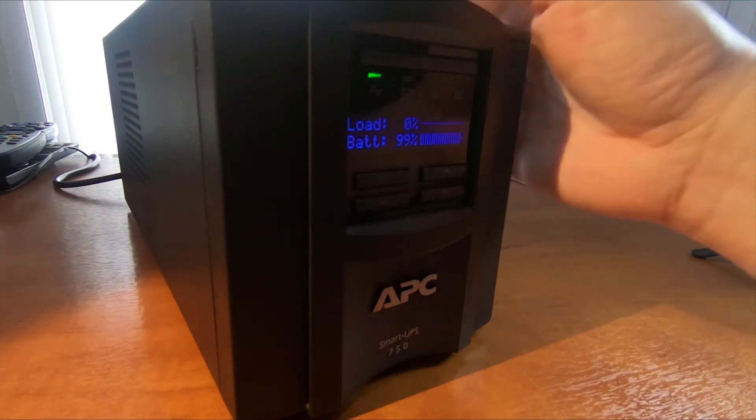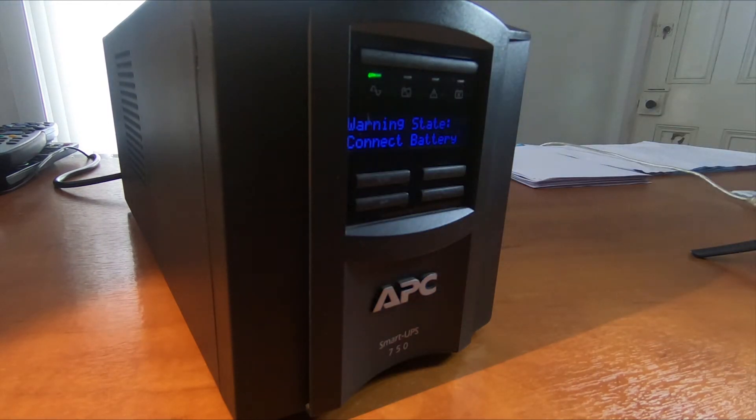Inside these, there are two standard sized lead acid batteries. APC used to, in their older machines, just allow you to buy one of these batteries and put it straight in. There were spade connectors on the cables, and you just connect up the new battery and slot it in. What they've done now is, to protect the replacement of these and make people order their own batteries, they've put a little connector on there which looks as though it's attached into the battery pack, but I believe it could be split apart and reused on some normal batteries — same specification batteries — which last just as long, but are a lot cheaper, as they're not this proprietary APC pack.